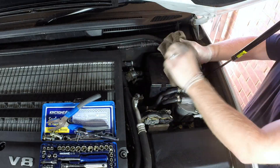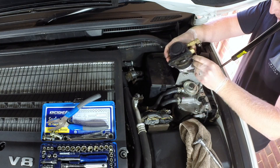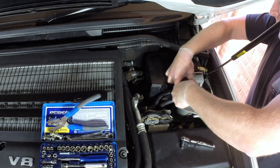If you do need to add extra hoses, try and make sure they are fuel-grade hose as the return lines can get up to about 90 degrees Celsius. Once you have finished the purge, it's just a matter of reassembling the system and then re-priming the fuel pump.